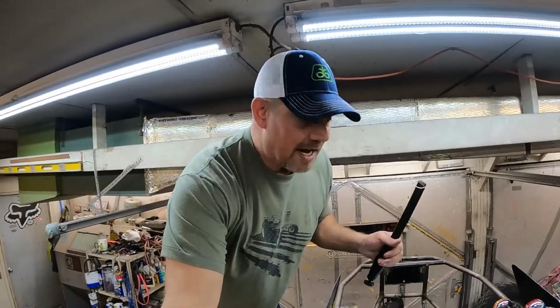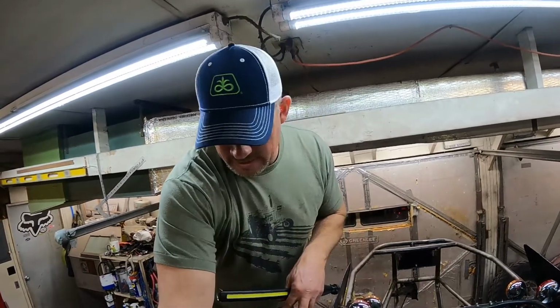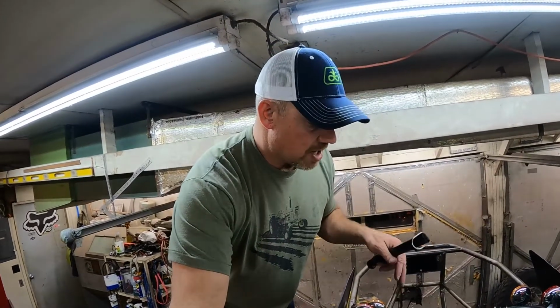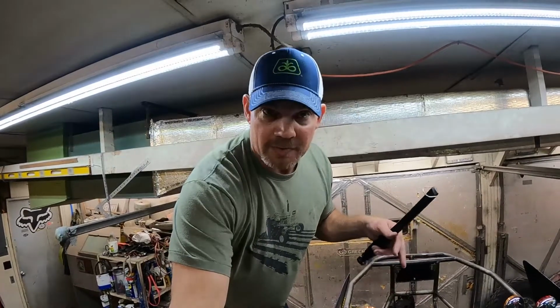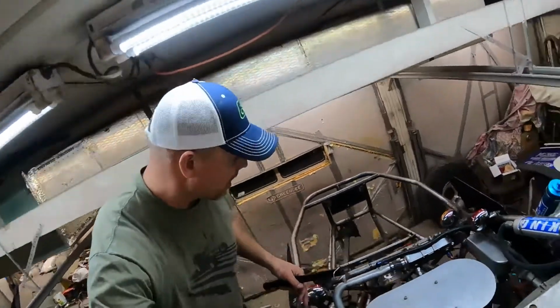Okay, so what we're doing right now is Kelly's gonna start the car. I'm gonna be looking in the dry sump and the power steering fluid reservoirs. Kelly's gonna be checking oil pressure on the front of the car. We're gonna start it up, let it run for a little bit, make sure everything sounds good. Remember, last video we rebuilt that oil pump, so we'll let everything cycle through, then check oil again. It's a cold start, so it's kind of cool. So here we go.